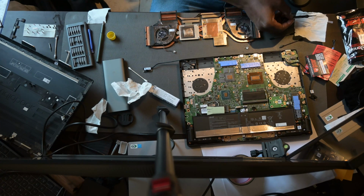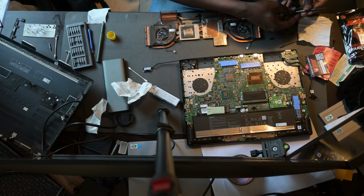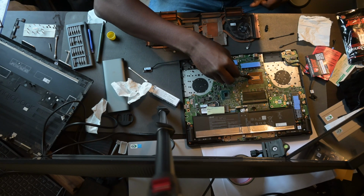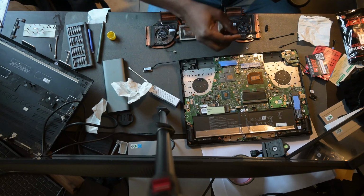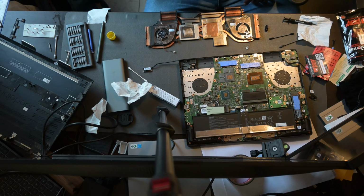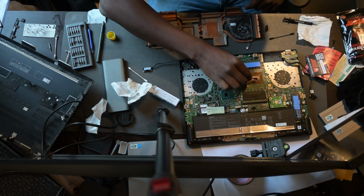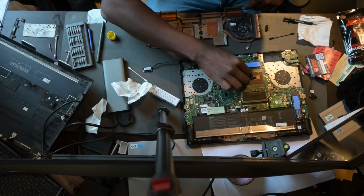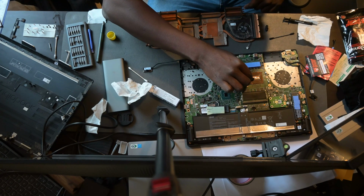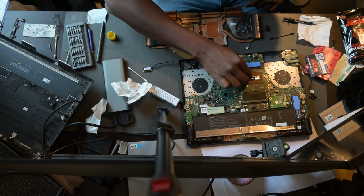Yeah, so for the placing of the liquid metal, one of the key things to note is you have to make sure that you've already been able to run it through the syringe. Why it's very important to do this is you can easily end up with a blockage where you're applying too much pressure, and what will happen is it'll end up spreading all over your computer's motherboard, and highly likely in that situation, you might short out something. Even if you think you've cleaned it out completely, it's very risky to spray any amount of liquid metal onto your motherboard. So always make sure you've removed at least one drop somewhere outside the motherboard prior to trying to place it onto the CPU die.